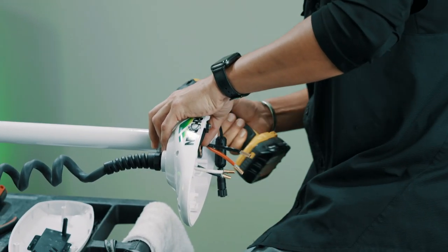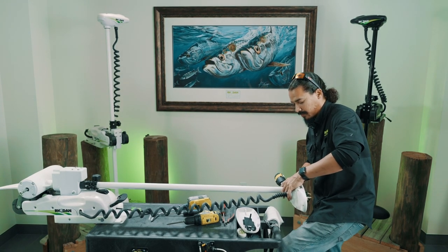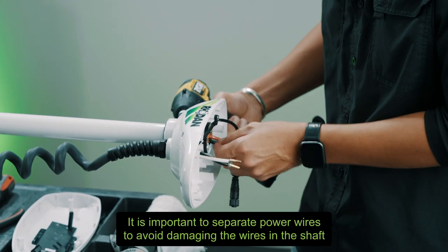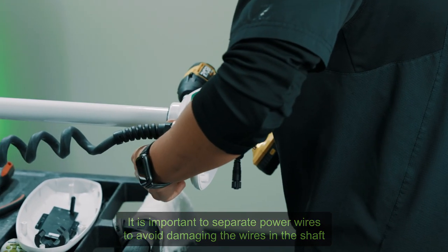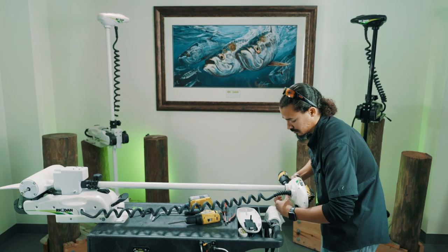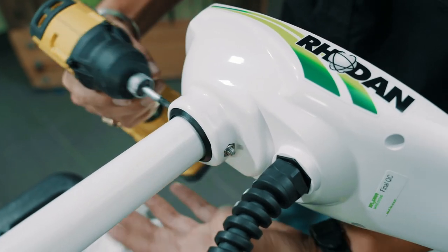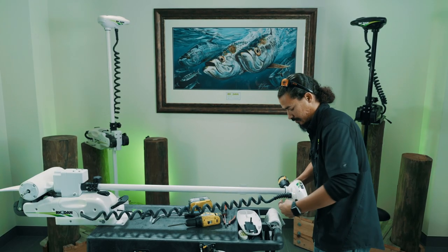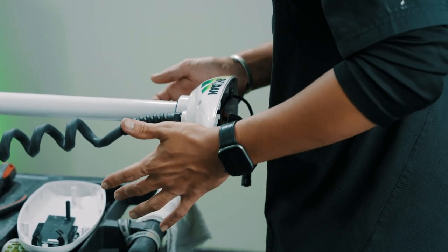This part's a lot easier with the drill. You're going to separate your power wires so that one is at the top and one is at the bottom, then run your bolt all the way through. Take your nut from earlier and put that in there — it should just go on nice and easy. If it's not going on easy, the head is crooked, so adjust it a little bit. Just give it a couple clicks — not too hard, you don't want to break your plastic.